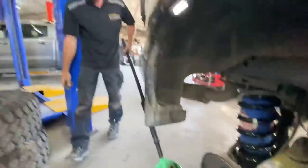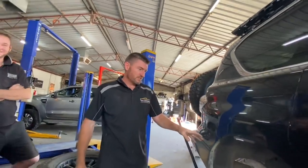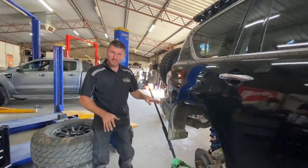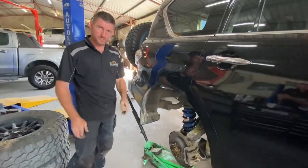That puts a lot of pressure on that ball joint and pops it. You've really just got to let it fall down on the jack, and if you can get it to pop it's going to save an hour trying to fight with that one little ball joint and save so much time.